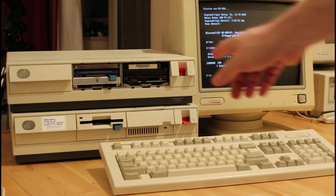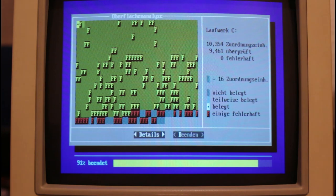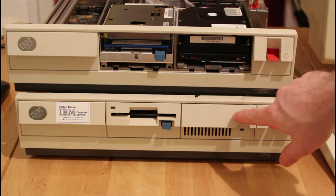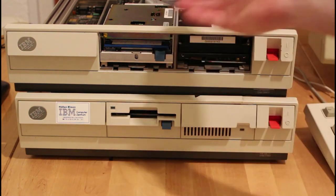I'm going to run ScanDisk to check the hard drives, starting with the second machine I purchased. The hard drive from the second machine has a lot of bad sectors — all those F's are basically bad sectors. It's not finding any new ones beyond those already found at formatting, but the drive is pretty badly damaged right across almost all of the surface. It doesn't add up to that much in kilobytes so it's still a usable drive, but it's failing pretty quickly and I don't think these IBM drives are very reliable.